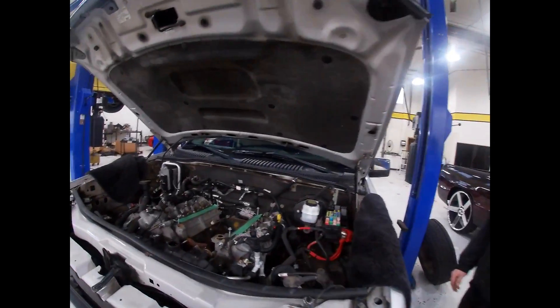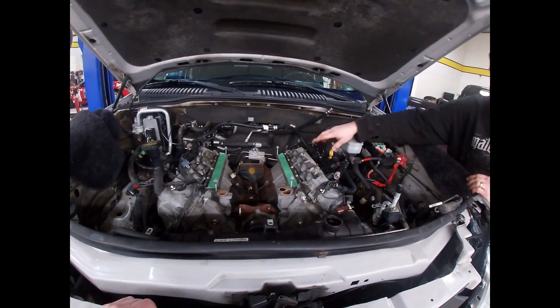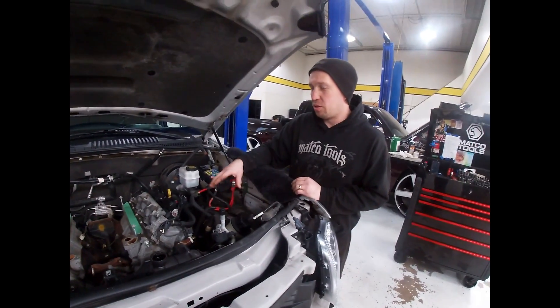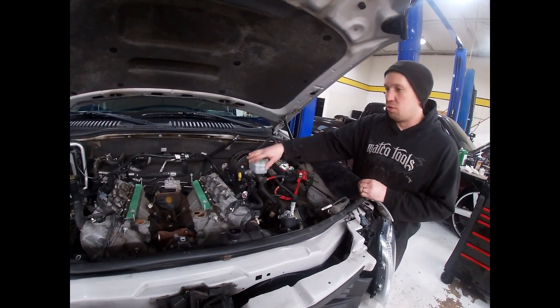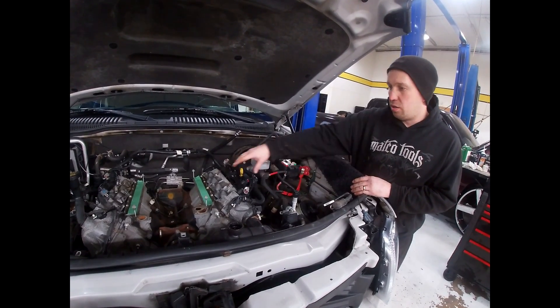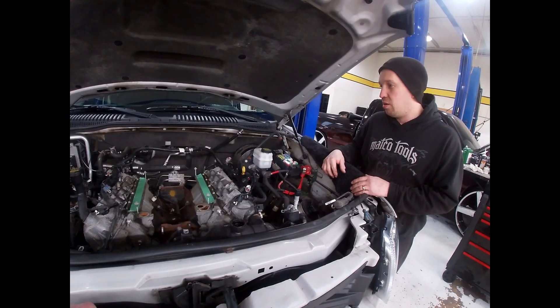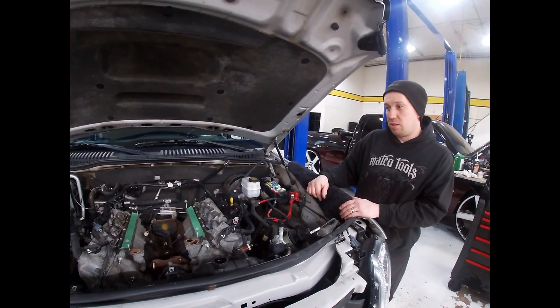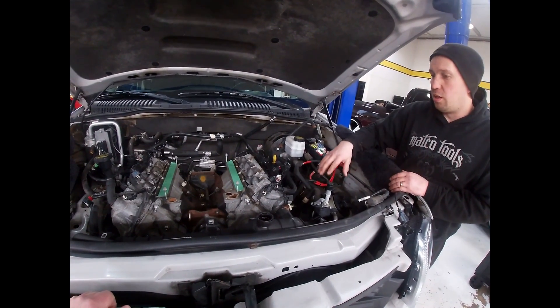The Sport Track is all apart now — you'll notice it's missing the intake manifold and everything else in the middle. We removed the fan. John explains the next steps: the Mustang instructions say to remove the water lines from the valley and reroute one to the outside, but this truck is already set up that way. So it's basically removing the intake manifold, the clutch fan, and accessory pulleys we don't need. We'll pull the spark plugs out to nick down the gap so we don't get a misfire under boost. Then it's just getting the supercharger ready to bolt on — it comes with a new water crossover pipe, so you move the thermostat and upper housing onto that new piece and all the hoses hook right back up. The supercharger bolts down as one unit; it's really one of the nicest superchargers to install.